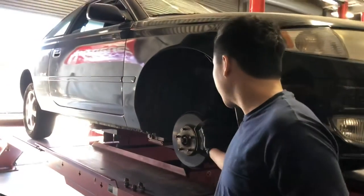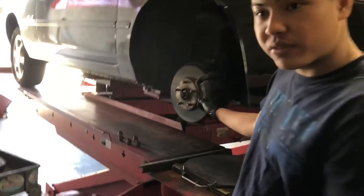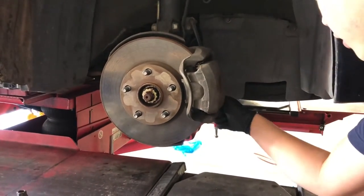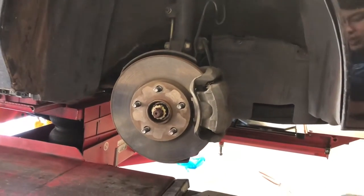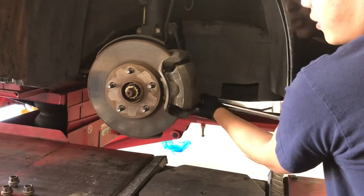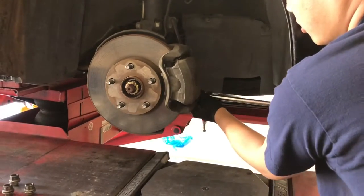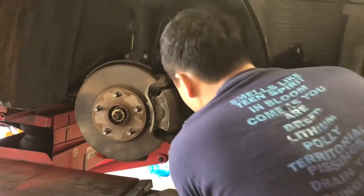The wheel comes off. Now I'm going to take off this caliper right here. This is what I'm going to be taking out. It has a 14 millimeter bolt, so I'm going to put a 14 millimeter socket into it and use a breaker bar to unscrew it. Now this will depend on where I am facing — counterclockwise is going this way — so on my side, where I'm facing right now, I have to push the breaker bar clockwise.